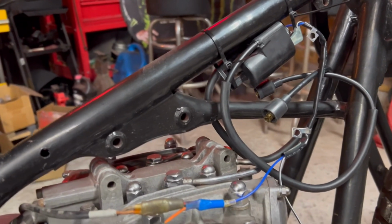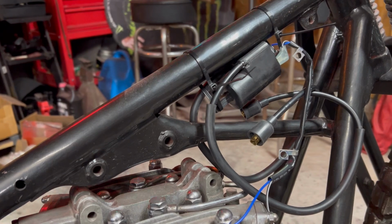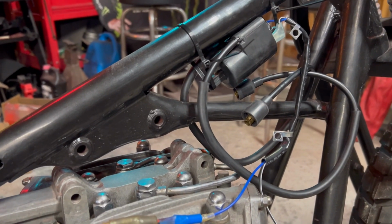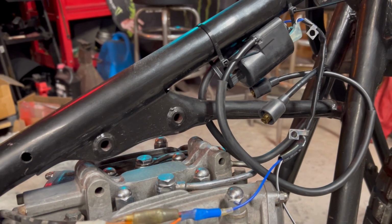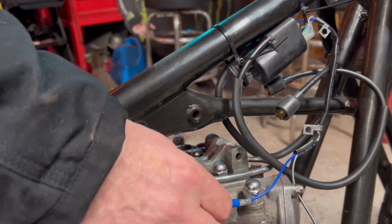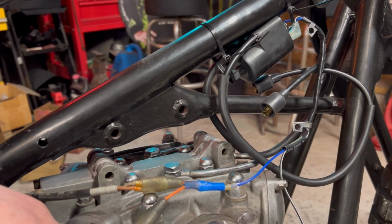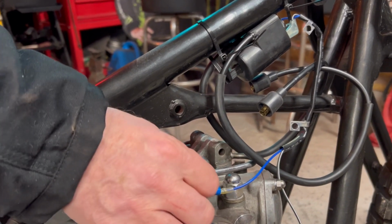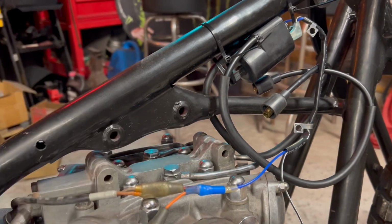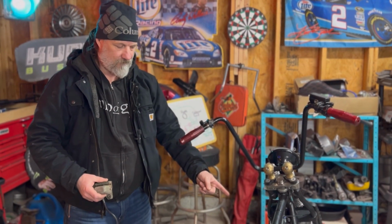All right. So, like I was telling Steve, this is 70. So all we need is power to the coil, which will give us points, and make sure everything's battery's negative sound. I think we're good. So now let's get our rectifier and all that set up, and get some spark plugs in, the exhaust on, get the battery on. So, coil set up, points are set up.